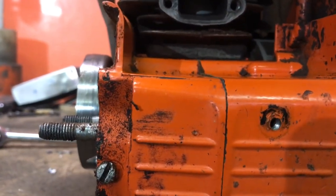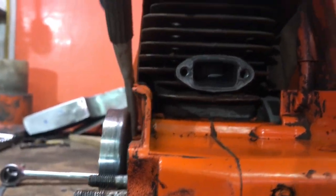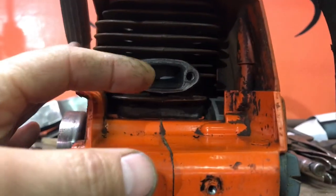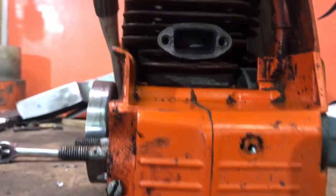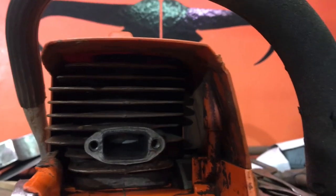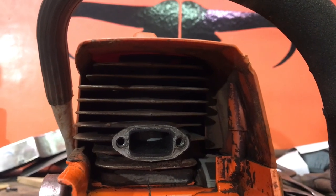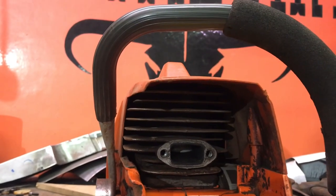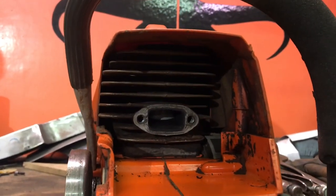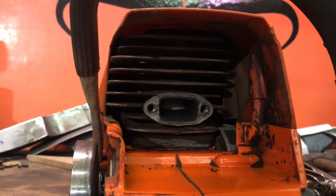So I just have to find some material, or else make these parts. If I could find some exhaust tubing that would fit in there, or if I could just squish it to fit in there, like an oval kind of cross section, that would be good. But I think I'm just going to end up making these parts, and we'll see how it goes. In my mind, a two-stroke engine needs an expansion chamber to really pick it up. So that's what I'm going for here.